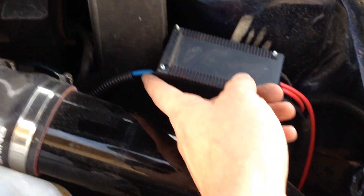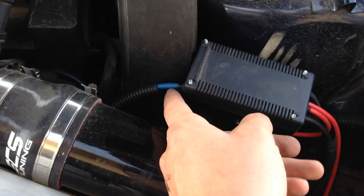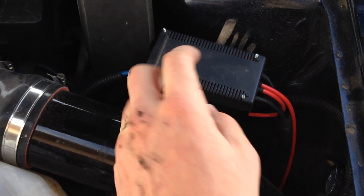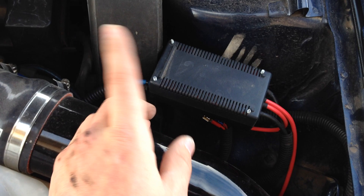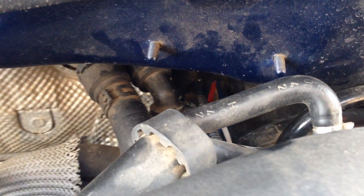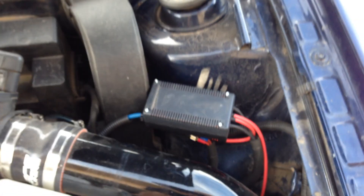I relocated the potentiometer that was on it — it was just a knob right there. I used a piece of Ethernet cable, so it has enough wires, because the potentiometer had six connection points on the board. It was like two potentiometers in one, one on each side, so I needed enough wires to solder up to both ends. This runs into the cab right back here. I made myself another grommet to go back through the firewall right there.